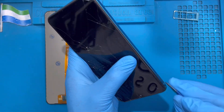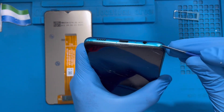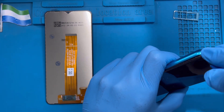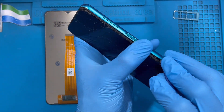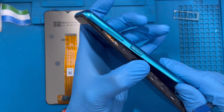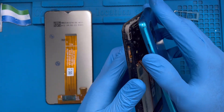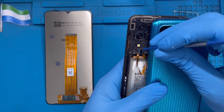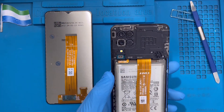Put it inside like this, then open the cover — just open all the clips, don't worry about them. Be careful of the fingerprint cable; just open it halfway like this, don't open it fully. You can use your nails if you have them.